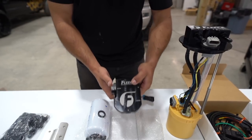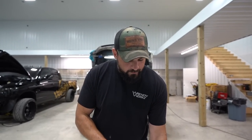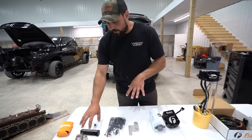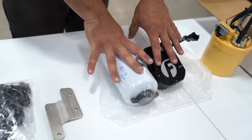So we've got this filter. This will actually bolt onto the side of the cylinder head. Some of this stuff we will need to put the cylinder head back on to complete in conjunction with our auxiliary fuel filter. Right here we have their fuel filter delete. You have to run basically this piece along with the filter base.